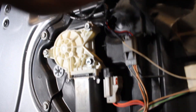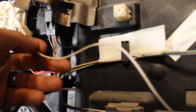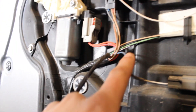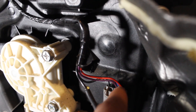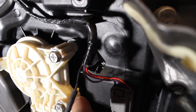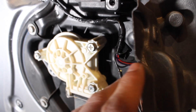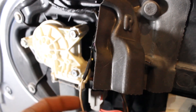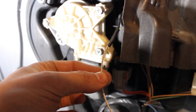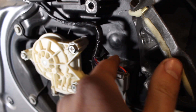When taking apart his door we realized this is the main plug for the heat. This white wire goes down and attaches to the main harness, but it looks like it was spliced in — they took out one of the black wires in this plug and attached it to one of those black wires. We think that's for the control so the mirror can move back and forth. His new mirror doesn't have this other plug, so we're just going to ignore it and leave it in there in case he wants to splice it in the future.